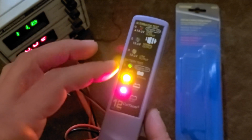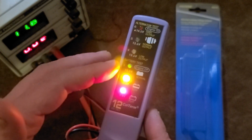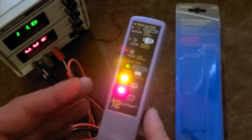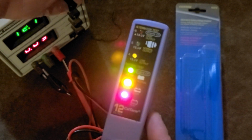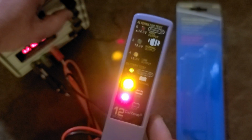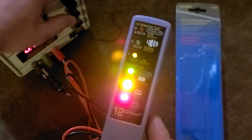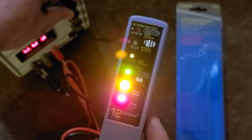You can see the crossover, the resistors, and the voltage that it takes to drive LEDs. These things aren't specific. They need a transistor control to actually make the lights just go straight on and off. It says it is good at 12.5, and this is what's hilarious, is we get quite a bit of the green light at exactly 12 volts, which is where it says that it's only at mid-charge, so that's not super great. We're at 12.3, so it's already a little optimistic.